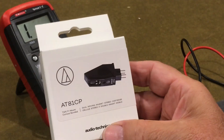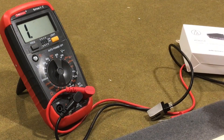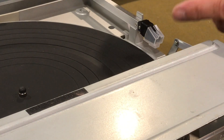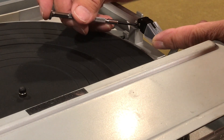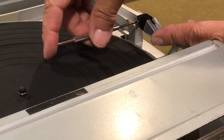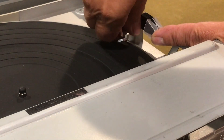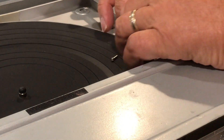The cartridge I bought was an Audio-Technica P-mount cartridge, and I got that installed — it's working pretty good. The easiest way, and maybe the only way, to replace the cartridge is to remove the metal cover from the turntable. Then you can access the cartridge and the mounting screw. First, with the tone arm in the resting position, remove that mounting screw.